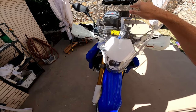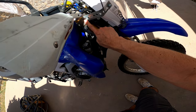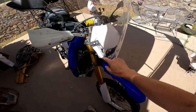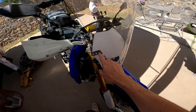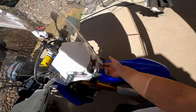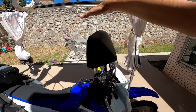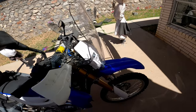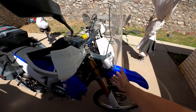Another mod was installing this V-Stream windscreen — brand new but from an old FZ1 I had. I made custom brackets out of steel that mount into the suspension clamps at the top and into the fender — it's super sturdy, one of the sturdier windscreens I've ever had. I mounted it low enough that it protects the Baja Designs light as well, and my head is completely over it. When standing on the bike I can tuck behind it without risk of it hitting my neck. Even up to 70 miles an hour there's really no wind buffeting, so the angle and shape worked out really well.